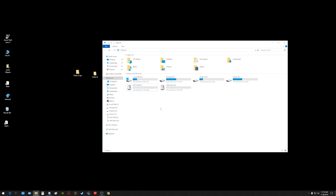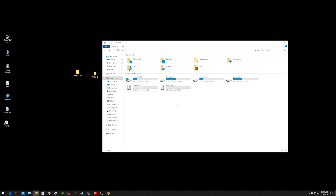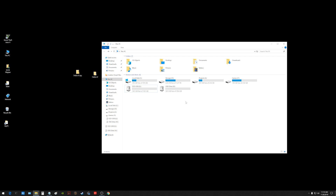If you're having trouble getting your drive to show up, consult your motherboard manual. You can try FAT32 or NTFS — whichever one shows up in the BIOS is fine. Try ejecting and then restarting, or try without ejecting, and see which way works for you to get the files to show up so you can select them and flash your BIOS. I hope you found this video helpful — if you did, hit the Like button and I will see you all soon in the next video. Thanks for watching.